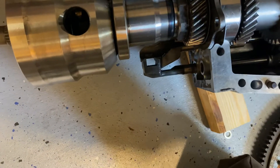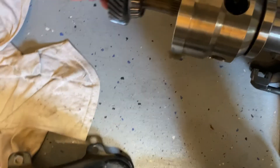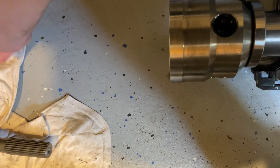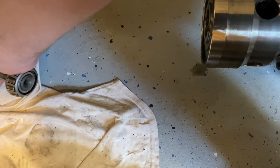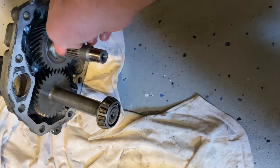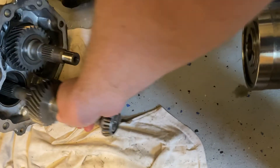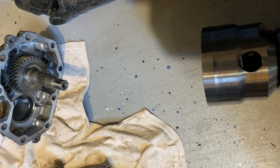The output shaft connects here for the rear axles. This piece was engaged inside the center differential, and this piece here connects to your drive shaft. The drive shaft has splines inside that connect to those splines on the output shaft. Then you have a one-to-one gear that transfers the energy to the back axles — pretty clever how the all-wheel drive works.